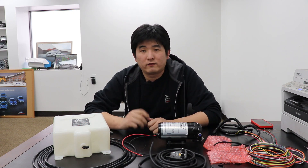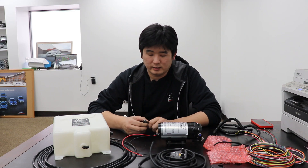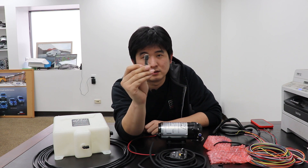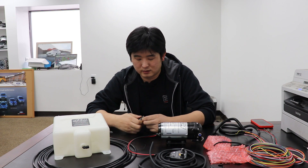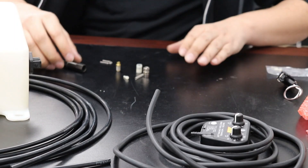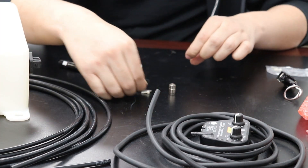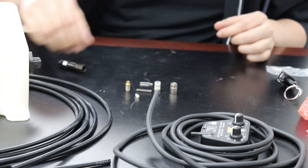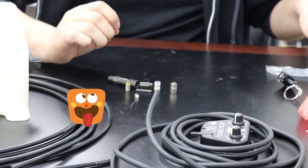The AEM kit comes with three different nozzle settings: 250cc, 500cc, and 1000cc, and they have recently updated their design so this is their v3 nozzle. For those of you that haven't seen this before, let me take it apart and show you how it's built. Okay, so there are a few parts to this. The nozzle actually divides up like this.